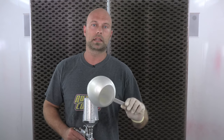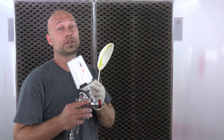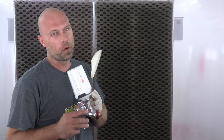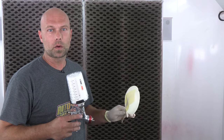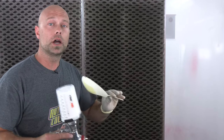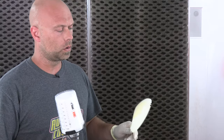So we're going to move on to our next color, which is actually our 6001 white sealer, and that's going to be the ground coat for our coarse metallic white and our gold. The reason I'm using it under the gold is because it's going to make that gold a little bit brighter and really gives a nice look to that gold.